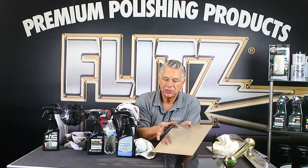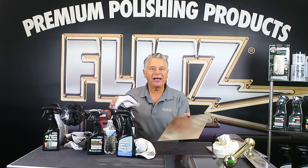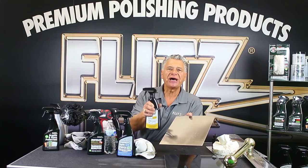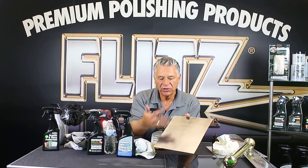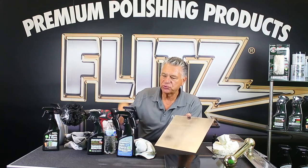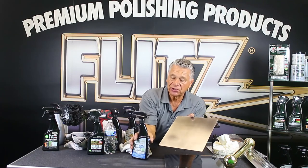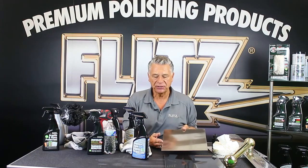Put this on your refrigerators and appliances — it not only gives a beautiful finish, it'll keep it that way. But you need to clean it first. If you've used oil-based cleaners in the past, you might need the cleaner two or three times first to get all the oil off. The stainless steel should almost come out white once the oil and grease is off — that's when you put your polish. This is fantastic in large areas. All these products come in the sizes I'm demonstrating, plus gallons and smaller sample bottles.